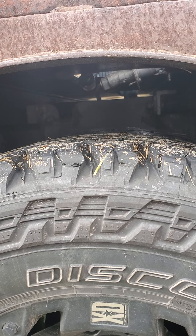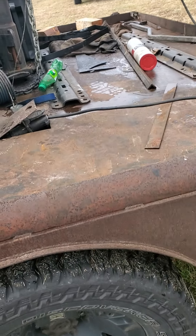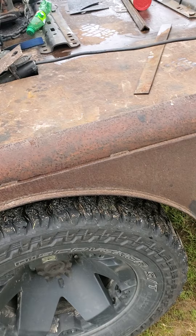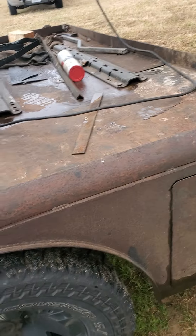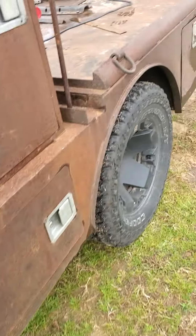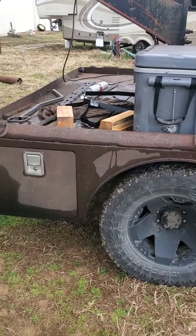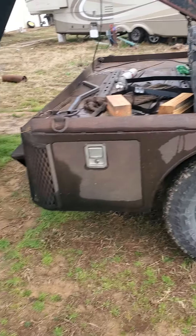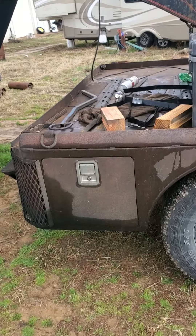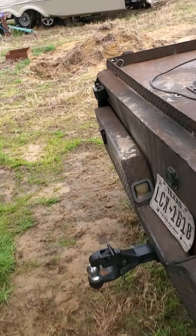Now you can see all this room — compressor's mounted right there. It's a tankless compressor, it just maintains pressure. Here's the remote — it's got three programmable pressures you can put it at. What it does is it stiffens your suspension whenever you've got a load. The remote goes right there. It stiffens your suspension so that you're not squatted all the way down, you get more suspension travel, so when you hit a bump you've got more suspension travel to take up, and it makes for a more pleasant ride and makes it easier to control.